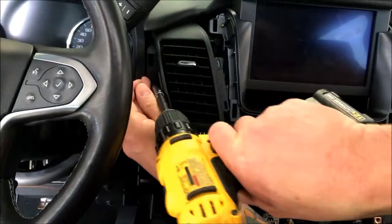So, that's coming out. The new one's going right back in. Always pay attention to where the label was, guys, coming out. I have seen these quite a few times get put in backwards. It's kind of hard to do because the harnessing is kind of designed to go in a certain spot, but I have seen it done. If you get this in flip side, like a pancake, and it's wrong, you're gonna have issues, GPS issues. So make sure this goes back in just like it came out, and we're just gonna plug things back in one by one.